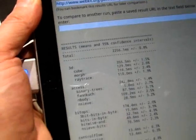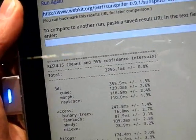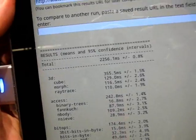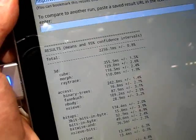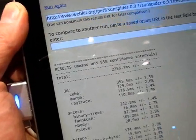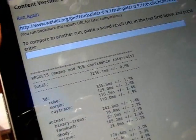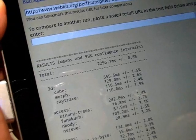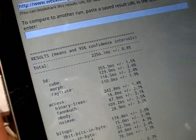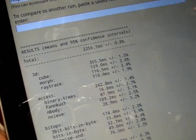Difficult to see on the video, but that's pretty much the same performance as you get from a netbook. I have to check — I'm not sure if this is a single-threaded or a multi-threaded test. There will be some advantages because the Dalvik runtime tries to use some of the second core for memory management. But that's pretty good — CPU performance levels on this are up there in the Intel Atom 1.6 gigahertz range.